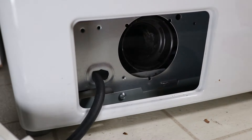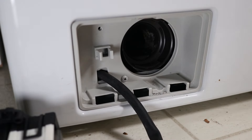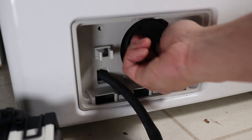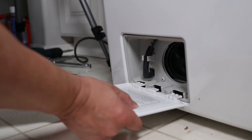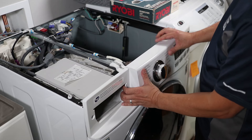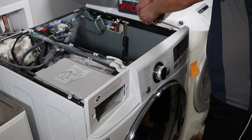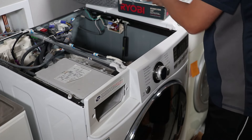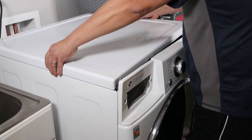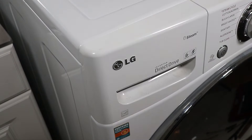At the bottom, put in the screw near the drain area. Then replace the plastic box and secure it in place with the gray screw. Put the coin basket back in and then reattach the cover. For the control panel, insert the bottom into the washer and slip it into place. Let's attach the top cover first and then screw in the two brackets on the back. Once the brackets are in place, the washer is all back together.